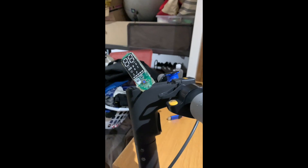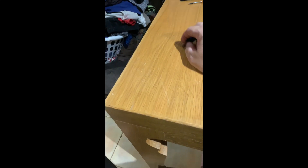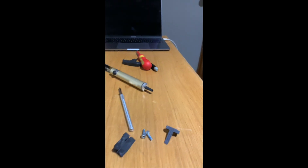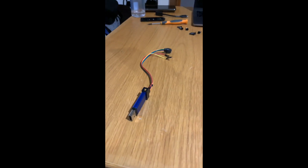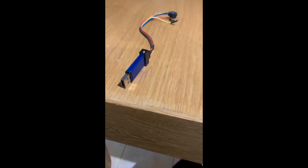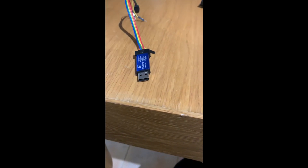Once we've done that, we're going to go on to flashing this with Bluetooth — BLE 555. The reason we're flashing this is because currently Segway have these dashboards set with encrypted Bluetooth, so communicating between the flashing software and the Bluetooth is virtually — well, it is — impossible without their correct software.